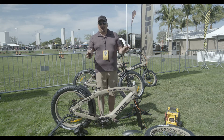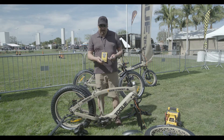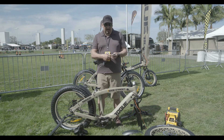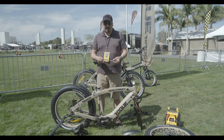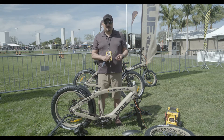All the bikes are set up the same way. The simple tools you're going to need are a box knife to basically unwrap the unit, a 5mm wrench to set the handlebar, and a crescent wrench — or what we prefer, a box-end open-ended 15mm wrench — just to set the pedals and tighten the bolts for the front tires.